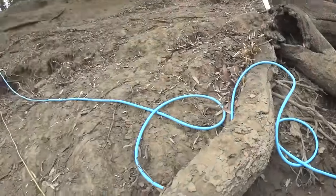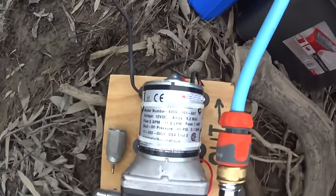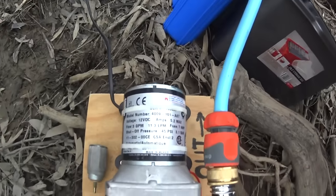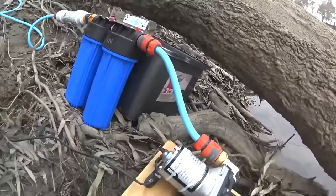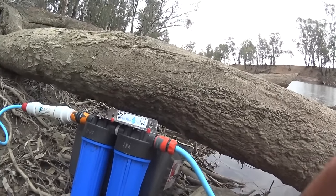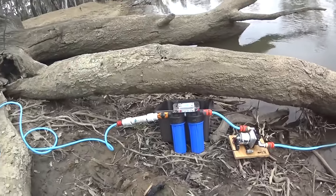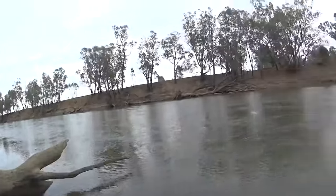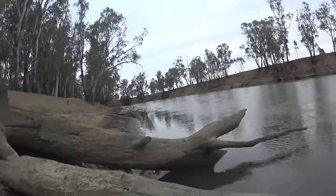And then I've got 40 meters of hose. The pump is identical to the one in our caravan — it's a 7 amp pump, 11.3 liters a minute. Obviously it doesn't pump that once it's gone 40 meters, but it doesn't get hot; it's doing its job. I've got a 10 amp fuse running this, so if that's not blowing, nothing's under too much strain.